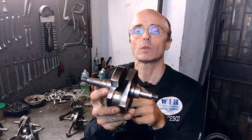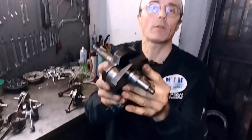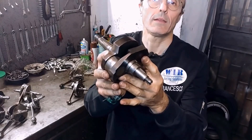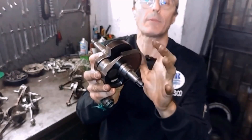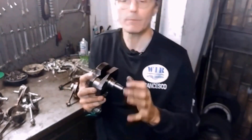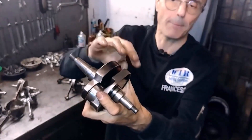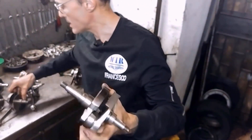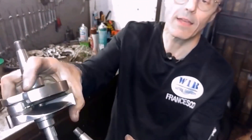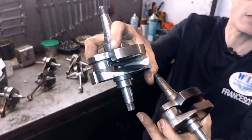Let us now examine the Mazzucchelli delayed shaft. It has a very significant delay. In fact, if you have one available, the limit represents the delay limit — not to be exceeded for any reason, especially with its shoulder shape. At the antipodes there is, with equal delay, the shape of the Mazzucchelli shoulder cut this way, and the shape of the Pinasco racing shoulder, which is hollowed out to the maximum, thinned inside, so as not to present obstacles to the flow at the inlet of the valve.